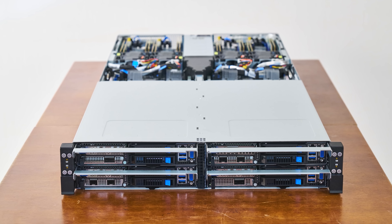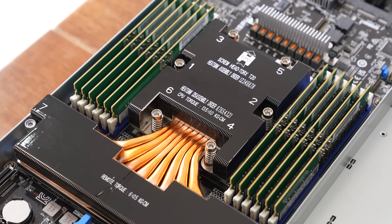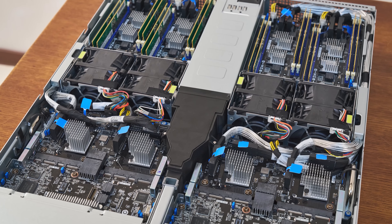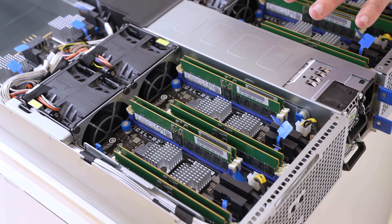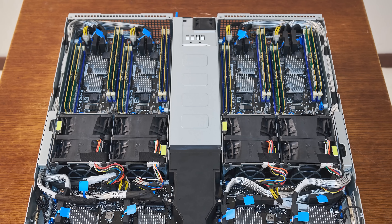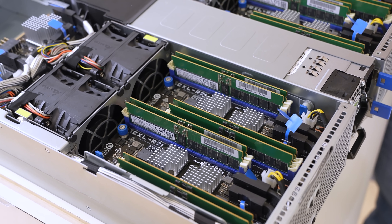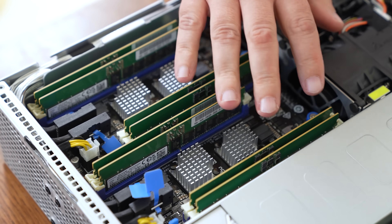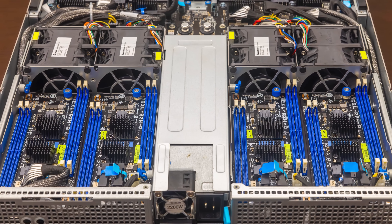In this ASUS server, using CXL memory with these custom modules in the back expands the memory footprint and DIMM count without sacrificing the 2U4-node density or memory bandwidth. In fact, they're adding additional memory bandwidth by adding those DIMMs via CXL controllers. Each node gets eight DIMMs with four controllers and two PCIe re-timers, allowing more capacity. In this example we're using 32-gigabyte DIMMs across both the CPU and CXL slots. This lets you use lower-cost, lower-capacity DIMMs instead of jumping straight to 128-gig DIMMs — use 32-gig instead of 64, or 64 instead of 128, with many options enabled by simply having more slots.